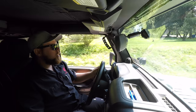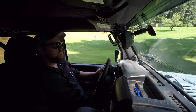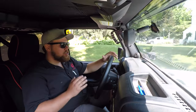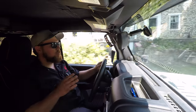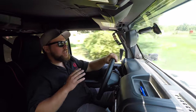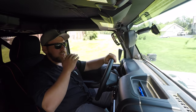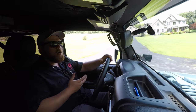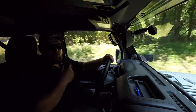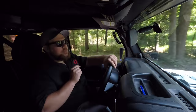Now that we're in the Jeep, honestly I was a little bit hesitant to see what it would do. It's not really a performance gain as far as horsepower and torque go — it's just to change that throttle input. Right now I've got it in sport mode at level five. InGen recommends that you don't go above level six — that seven, eight, nine level — unless you're off-road or on a track, because it's pretty serious. I put it up to number nine and you can honestly feel it just ramp up, but I'm going to keep it at five.